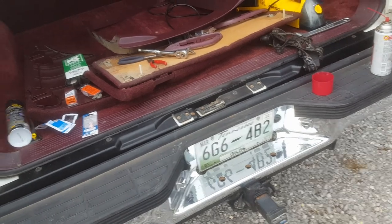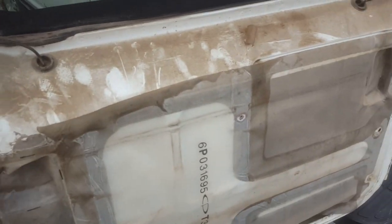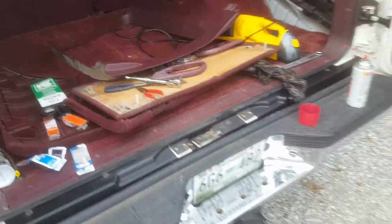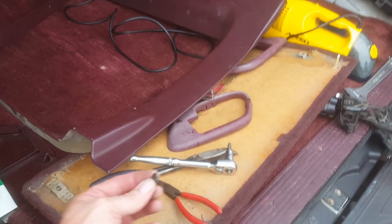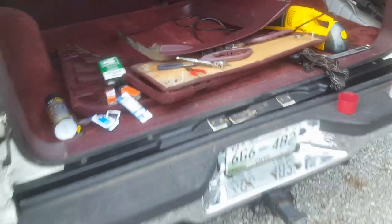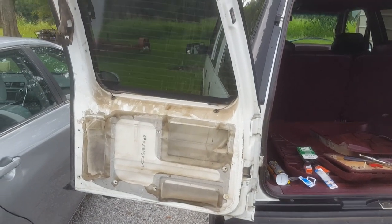That's exactly how it should work. I did the upper one because there's not much adjustability in this latch assembly. I carefully tweaked this one downward a little bit because it sounded like it was hitting the latch up there too high. That's got that fixed. I've got a spare clip — I'll keep that until the next one breaks. I still got to do the check strap, but now I can clean this up and put what's left of the weather seal back on it and then put the door panel back on. If you're having rear door problems with one of these, look at the adjustment and the clips first. Just go buy the proper clip — it'll take you less time than wrapping bailing wire around it, and it'll work.